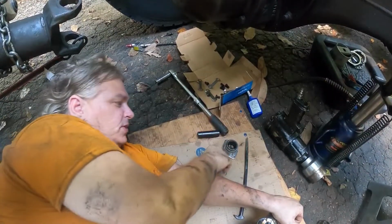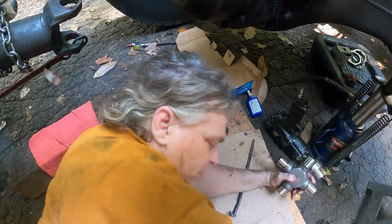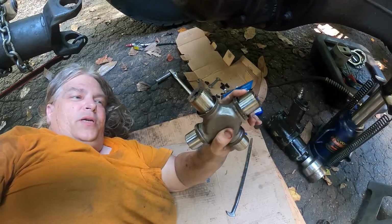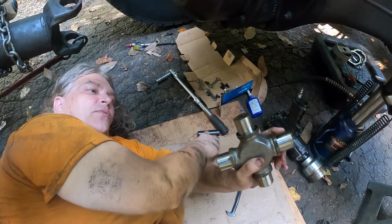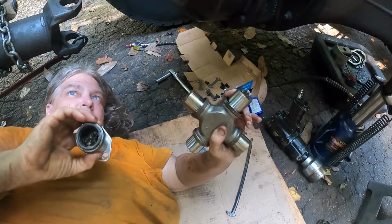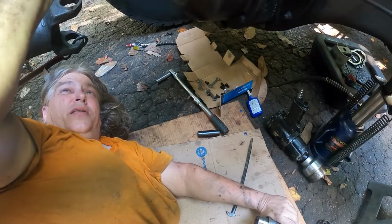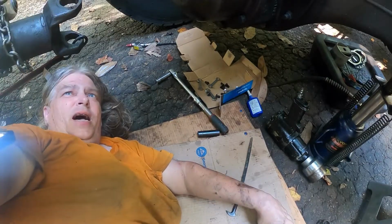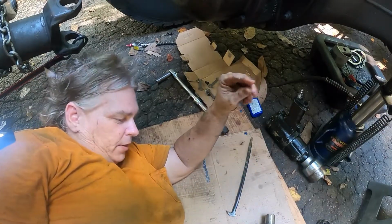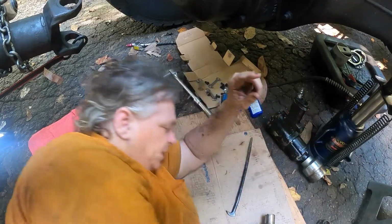So I take all these caps off, and I make sure that three of them, when I go to start, are out of the way, because I don't want a lot of dirt and stuff falling into these caps, because there's needle bearings in here and it takes grease. Now, most of the time they will not just fall in. I have never had one of these just fall in. So what I wind up doing is beating them in.